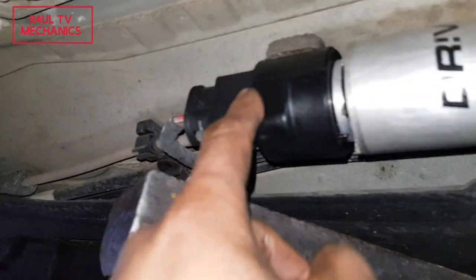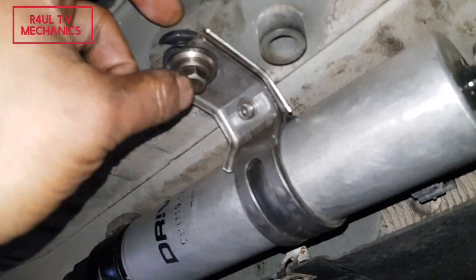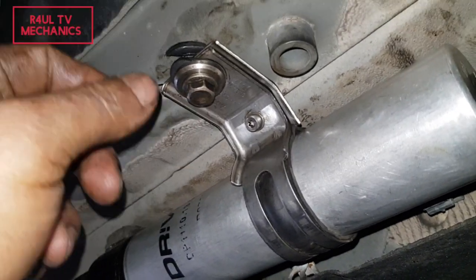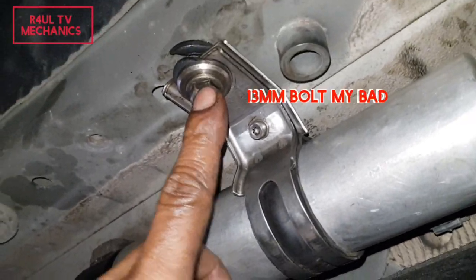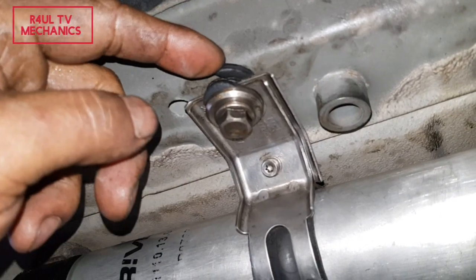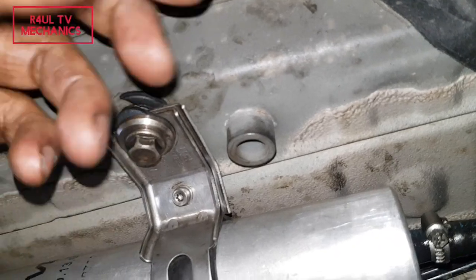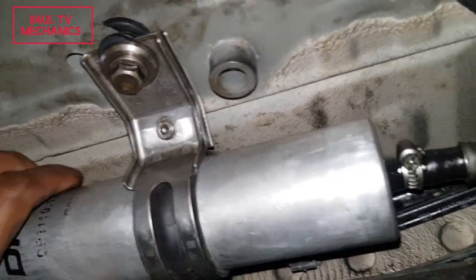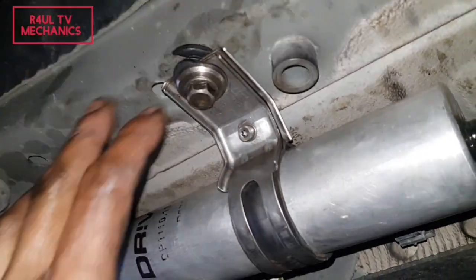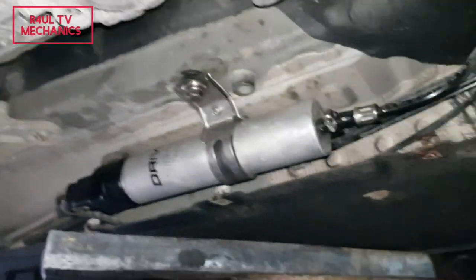This clamp is back on with the clip and everything. For this side, you need to get the rubber in there — there's a little sleeve that goes on as well, then the 30mm nut goes on. It's really hard to get that rubber on, so what I did is cut the rubber in half — one half on top, one half on the bottom. Happy days, that's on. Got the Torx 20 back on — that's done. Let's get the cover back on and start it up.